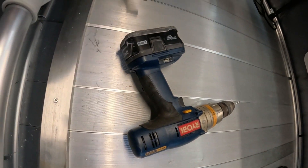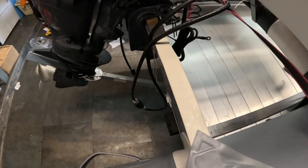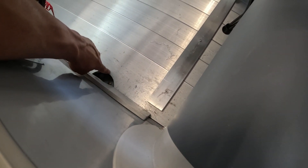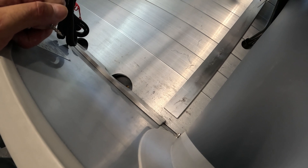I'm running screws every three panels and sticking one in there — I'll probably add more at some point. What I did here to ensure it wouldn't cause any problems: I slid the end of this spine over the floorboard and held the screw up to where it will penetrate to ensure that it would not penetrate the bottom level of the aluminum floor.